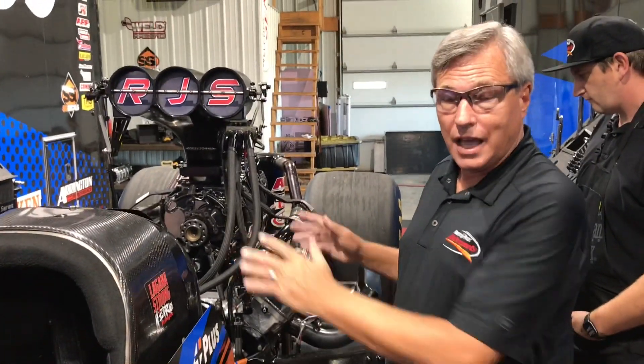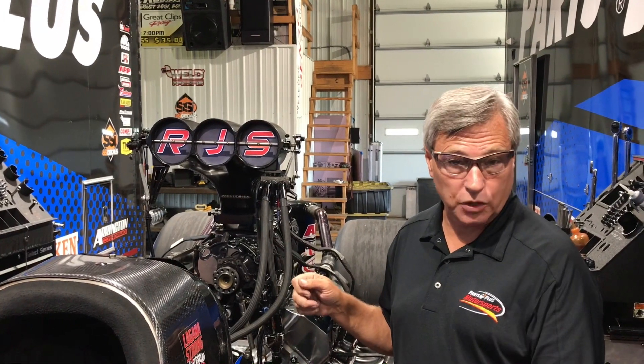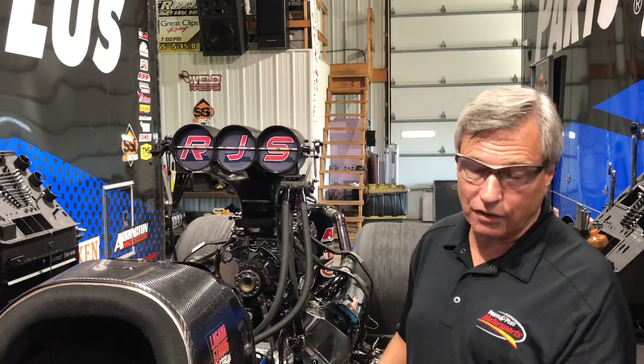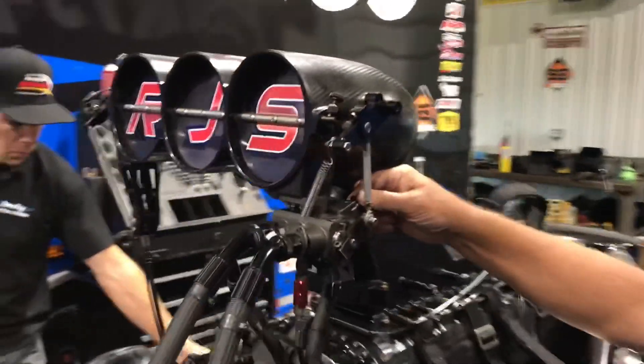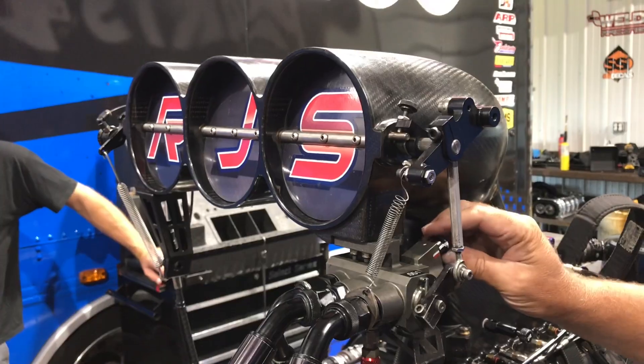Then I will take a look at the headers — I'll look at the exhaust pipes to see how the engine's running. If the engine looks like it's heating up and the pipes are not quite as wet, I might reach in and adjust the engine. Vice versa, if the engine looks really wet and rich, I might lean it down a little bit. Right before we pull into stage, I'll warm up or cool down the cylinders as needed, then set the idle screw to the full rich launch position.